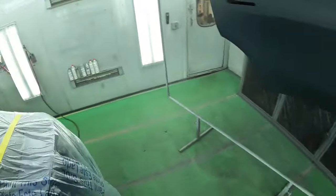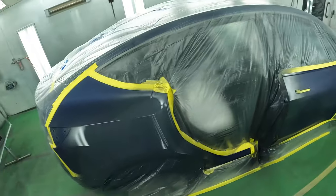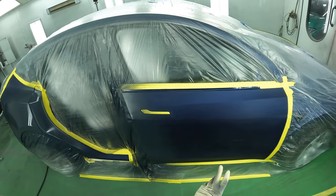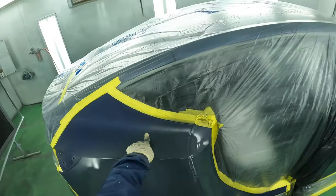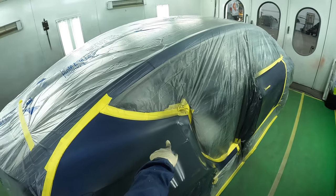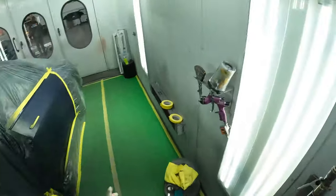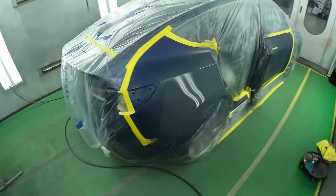Same with the quarter panel. That looks a lot better than it did before. It already has the right proper G shade and it's a lot closer match to the paint. And we have a super smooth transition from gray to color, so it's gonna be a lot easier to cover. We're gonna let that dry and we're gonna move on to mixing the base coat.